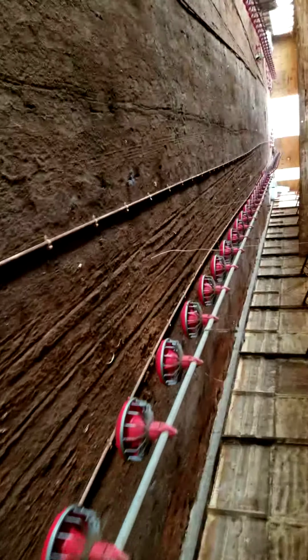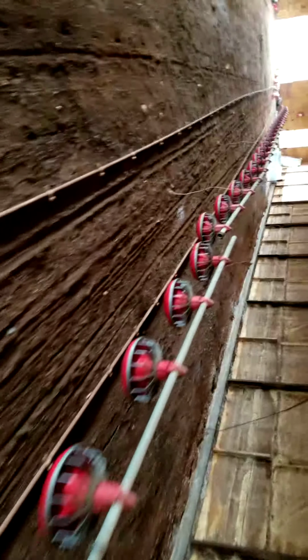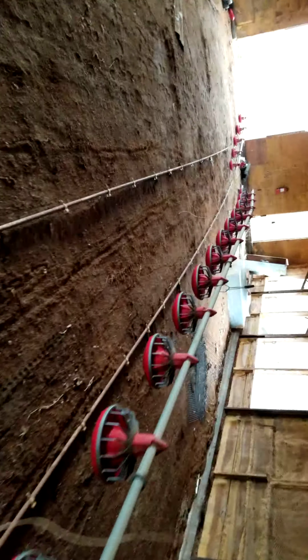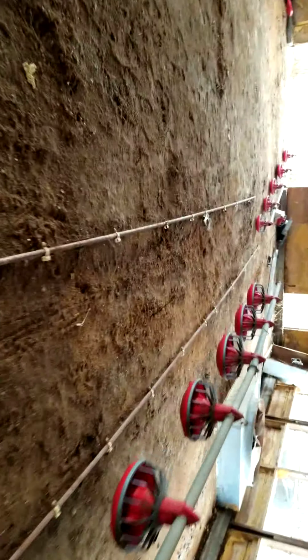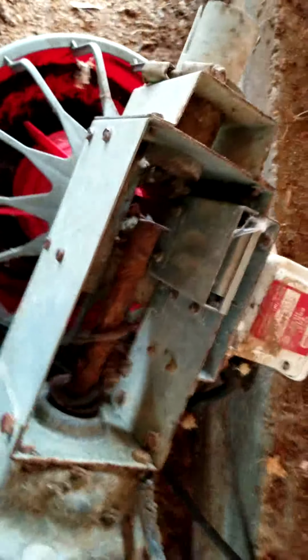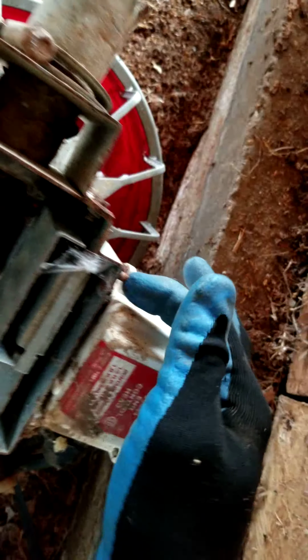And at the motor, you just have to take off the top shield, and it should just be on like a clip or maybe a small screw holding it on. But take off the top shield so that you can get into where the auger is held on to a shaft, and I'll show you that here in just a second. I already took it off, but here is the motor, and so there should be a shield right here. Not exactly sure where it is, but anyways, the shield will clip right on this side, and then there's a small tab right there that it kind of hooks into to hold it good.